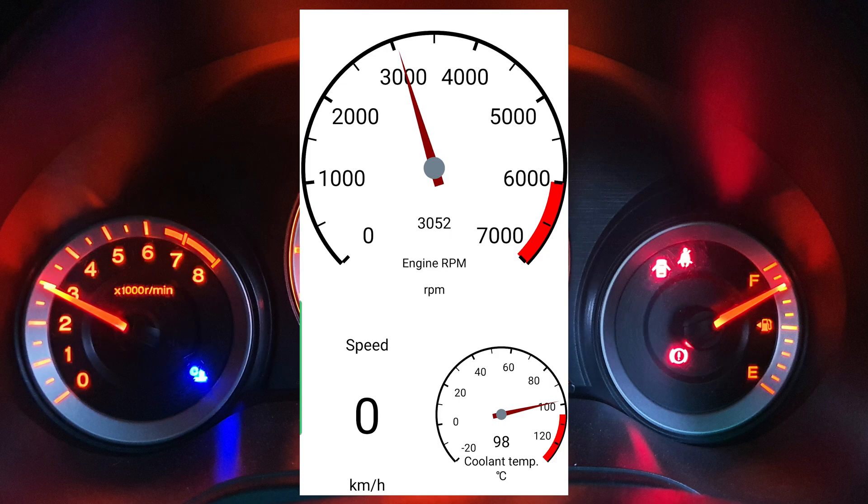At 98 degrees, the fan should be turning on now. You can see the temperature drop, so I'm letting go. Sometimes it's a bit hard to hear the radiator fans with the engine running. I've let go of the throttle — just let it idle for five minutes, not including radiator fan time. In between, it may drop below 3,000 RPM — that does happen to me at least once. Do not worry about it; just accelerate back up to 3,000 RPM when you can. Thanks for watching.